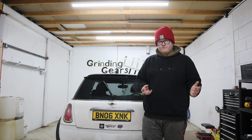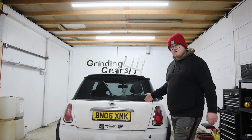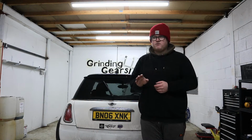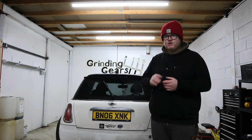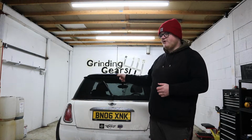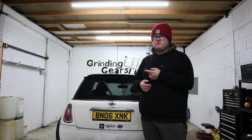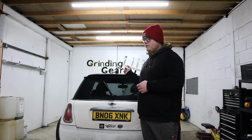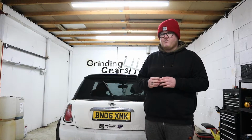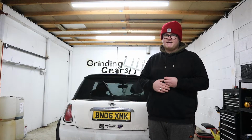I hope you enjoy. So the first victim is Chelsea's Mini. She's been moaning that it needs brakes for a while, and the brake pedal, she said, just goes a lot further than it used to. And then it started making a horrible scraping noise on the front left. So we brought her in here the other week, and I took the wheel off. And yeah, there's like minus brake pads left. There's literally nothing on there, metal on metal, and it started to dig into the discs.